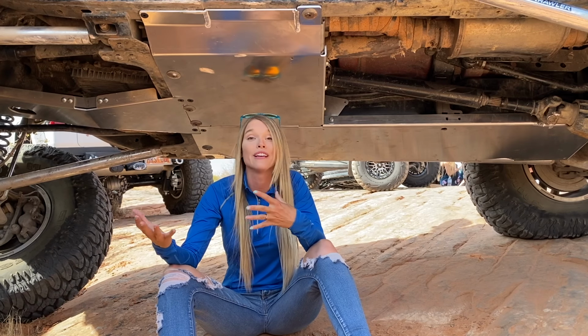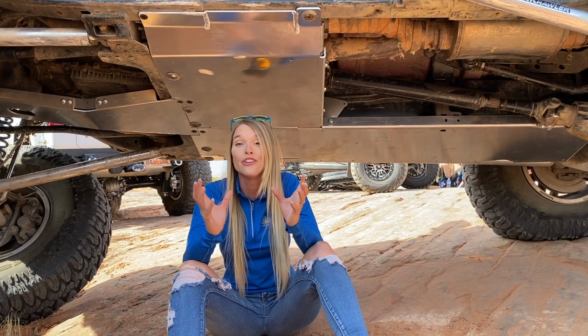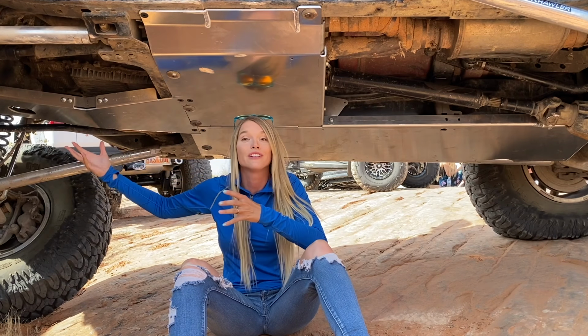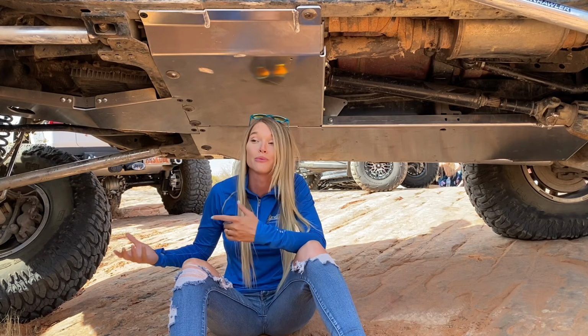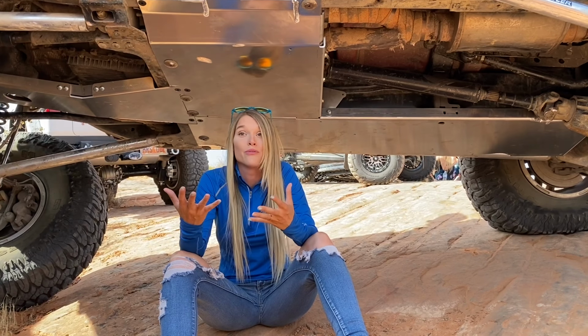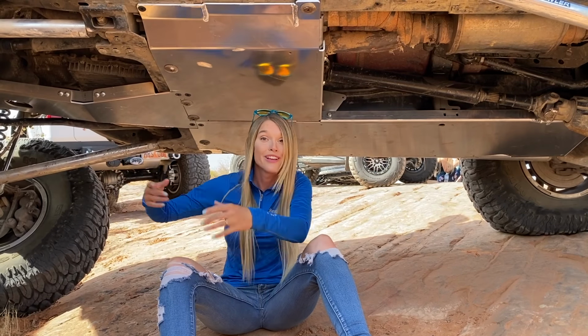So as far as the Hemi goes, it now bolts up perfectly to the new engine motor mounts. And of course, the oil drain hole right there was shifted so it is actually functional for us, which our old one was not. There's nothing on the market that will actually work with the Hemi swap. Until now.